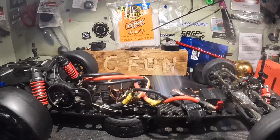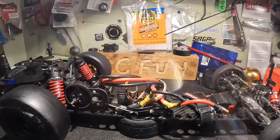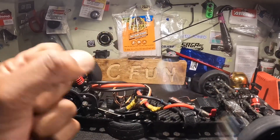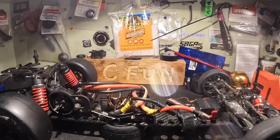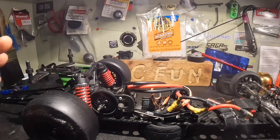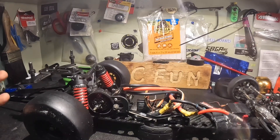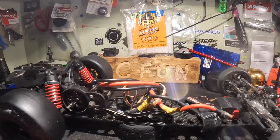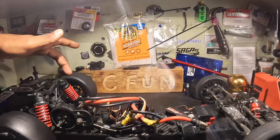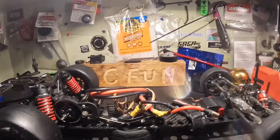Brought it back and the tire was flat again. The next race up was Benji. I ended up putting another old tire on the left and had a new one on the right. When I took off the car was straight, then started to pull — I had to let off and get right back into it. I ended up taking the win, but it was a tricky day with the air tires. I'm not saying the air tires are at fault because they work good — I used no heat all day. From the first prep I put on, it was sticky for the rest of the day on a cold day, which was a great thing. But the worn tire growing too much on the left side was pulling, so I had to stay where I was at power-wise.